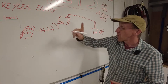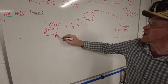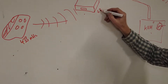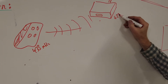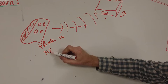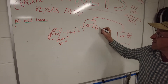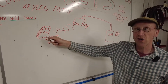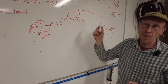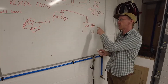The easiest one to change is the radio receiver module, but be careful — these two components work at either 433 megahertz or 315 megahertz. They need to be on the same frequency. 433 MHz is the UK and most of the world, but US regulations dictate they have to run at 315 MHz. So make sure you buy a US key and US receiver if you're in the US, or the 433 if elsewhere — swap like with like.